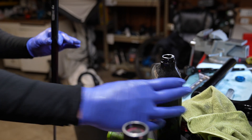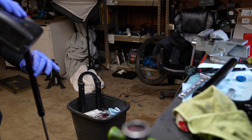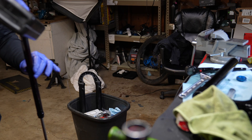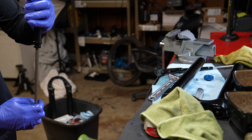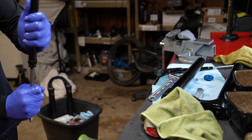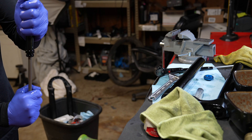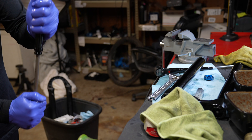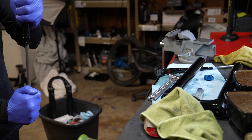Make sure you use the 5 weight Fox oil — the Teflon infused stuff. Take the compression assembly with the top cap removed and fill it up with oil. After it's completely full, take the rebound rod — that lower piece — and stroke it until it stops making noise. Check the oil to make sure there are no bubbles in it, but be careful because oil can spray.